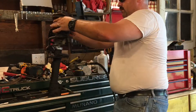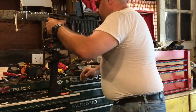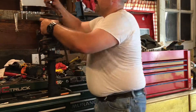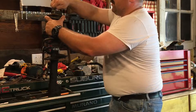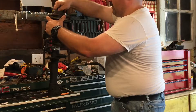The top here is not grooved in any way, so that will just sit on there any way it needs to. One thing I learned the hard way is you need to make sure that you use the new hardware — the new bolt that comes with the new strut — because they may not always be the same threads. I learned that the hard way one time.